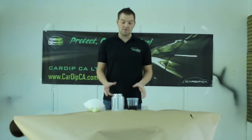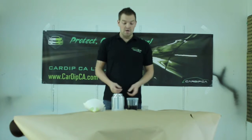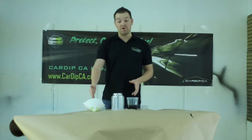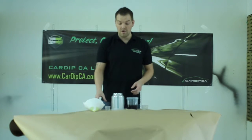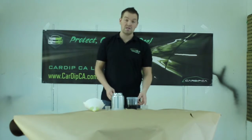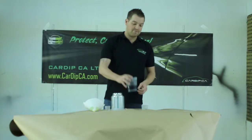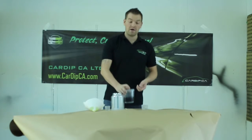Today I'm going to be talking to you a little bit about how to properly mix your product just before you're getting ready to spray. So what we got here is a couple different things. We got our 190 micron paint strainer. We have our product CarDip X-Linker. We have our CDR400 as well as our color tinted gloss product. This is our Onyx Black, brought to you by CarDip.